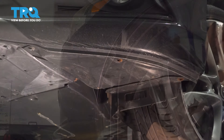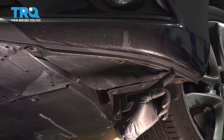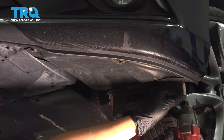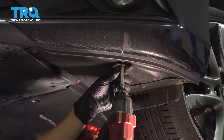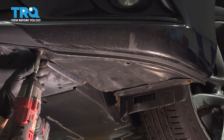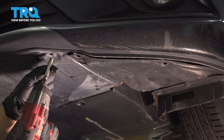There's going to be an 8mm screw that we have to remove — it's going to be a little tricky to see, but if you stick an extension with an 8mm socket right up there, you should be able to remove it. Underneath the vehicle, you'll see several 8mm headed screws. Start here and just go on the perimeter of the bumper cover and remove them all. These shields will kind of droop down a little bit, but they won't come off completely.